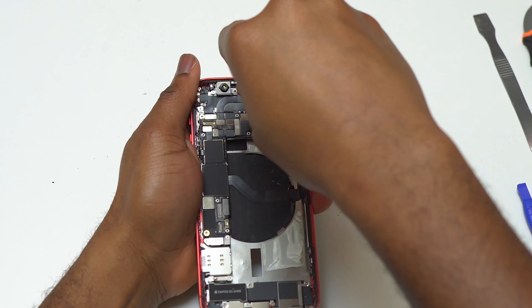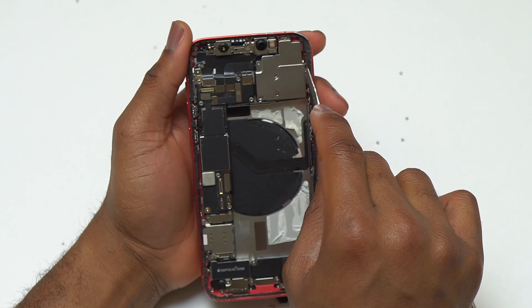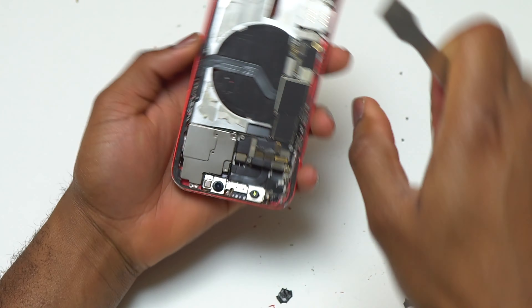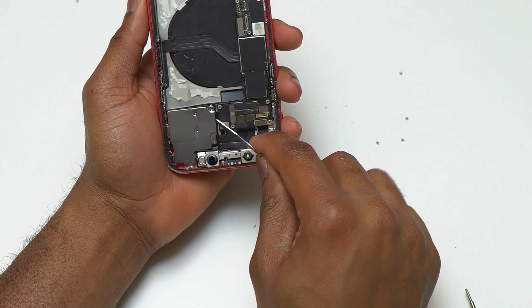After those have been completed, we can start the removal process of the screws and all the other components inside your iPhone 12. I started with the camera because that is the easiest thing to remove first. The camera is held by a retaining plate with five screws — but as you can see, I had one screw that was stripped.